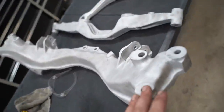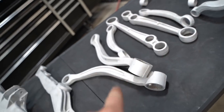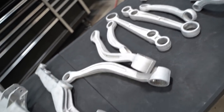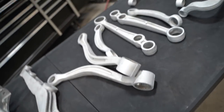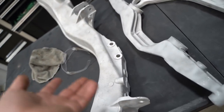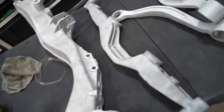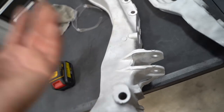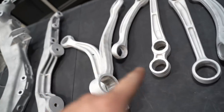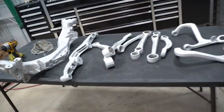It's going to be satin aluminum - I think it's H151. All of these parts are going to be gassed out in the oven for one hour at 350 degrees. I would do these two pieces but our oven is too small - I know I need to upgrade, one day we will. You don't have to do the gas out cycle, especially for stuff like this where it's not an engine part - I'm not super worried about doing the gas out phase, but obviously it's better to. Let's get all these parts in the oven - 350 degrees, one hour. Pull them out, let them cool down, and all of this stuff is going to be looking brand new here within the next few hours.